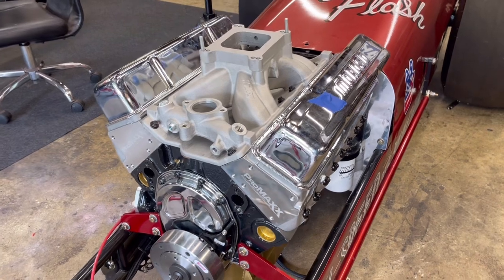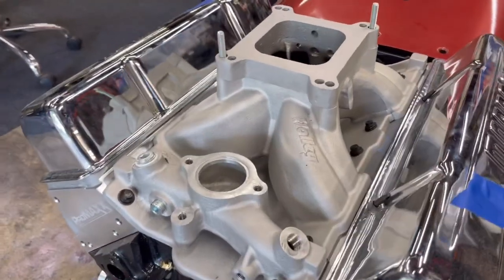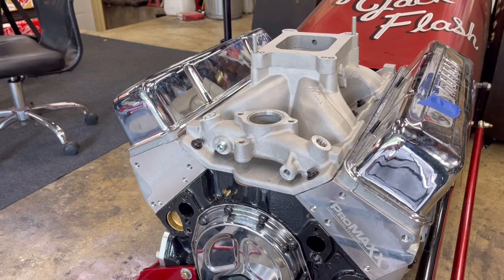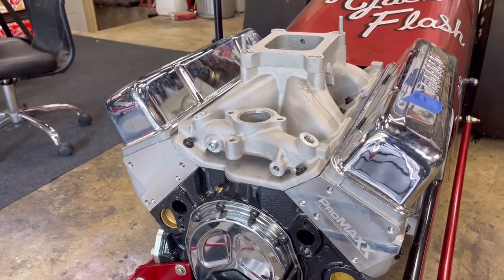So there we go. Intake manifold is all installed. Like I said, it's a Holley single plane, and I'll put a link in the description. The reason I chose this, like I said, is the application, the cam I'm using, the RPM range that I want to go with, along with my stall converter. This was a perfect choice for it.